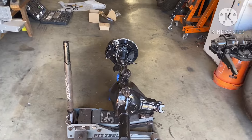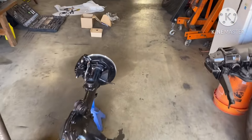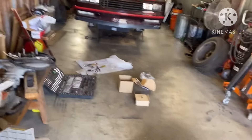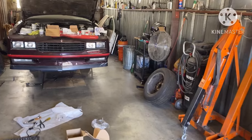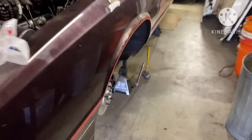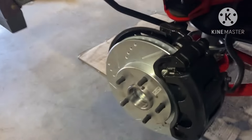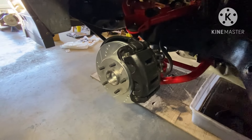You don't need a nine inch with 400 or 500 horsepower unless you're going to put some slicks on there with a trans brake. That old seven and a half is gonna hold all day, gang. Save that extra $1,500 you were gonna spend and use that on something else on the car, like this pretty suspension right here.